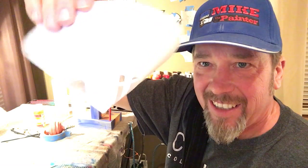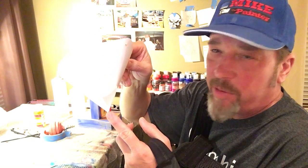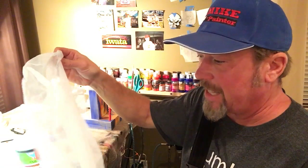Something I just touched on briefly before is the need to possibly strain your paint. I don't feel like I need to do it very often. A cone strainer - some of these are pretty good. I didn't buy these for airbrushing; I bought these for doing some cabinet finishing, and it's got a real stupid configuration to the cone. This is just an example, but you've got to find one that has the screen right down to the bottom of the cone.